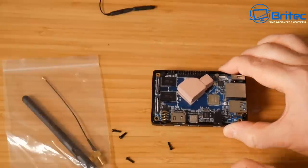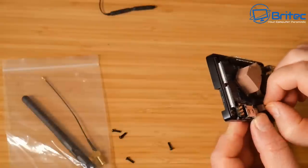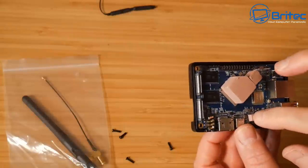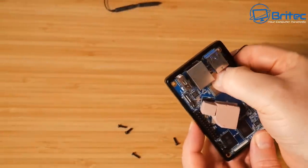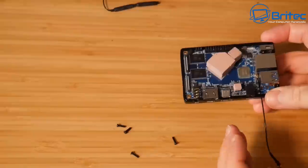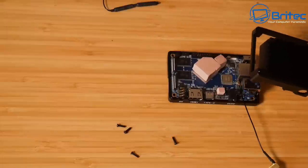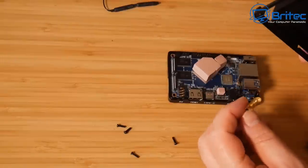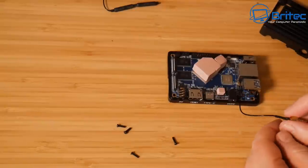There's also a little tiny one that says Rockchip on it, and I'm going to stick that on too, as this is how they come. I'll take the plastic covers off these thermal pads — they'll help cool down the CPU, GPU, and chipset. I then need to attach the WiFi antenna; I've clipped that into place. They can be a bit tricky, so just take your time. There's a little hole and section to push the antenna through, and we go ahead and clip that in.